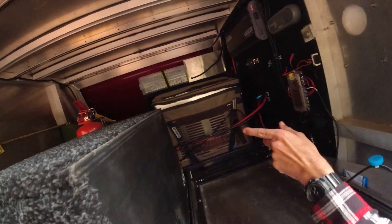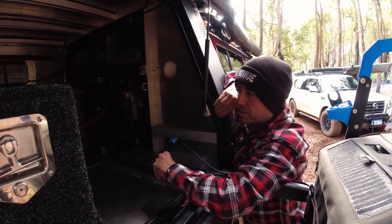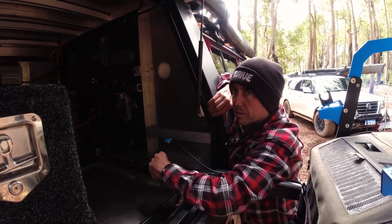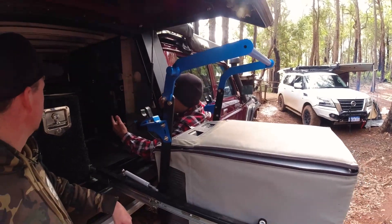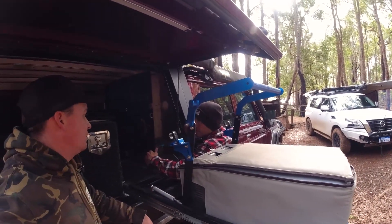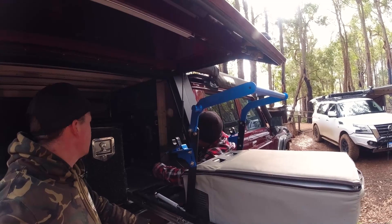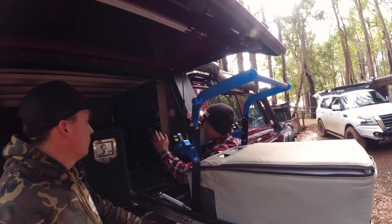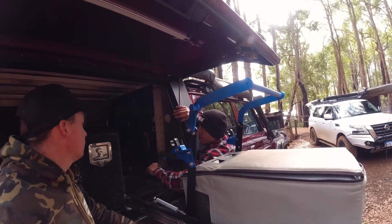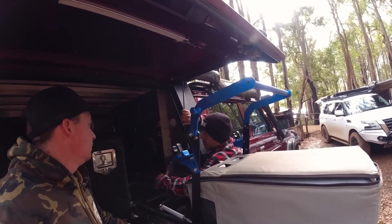The battery I got from Allspark Off-Road Living in Perth got destroyed in my rollover. But they've got another one — the 150 amp, which is just heaps. You have lithium in the old one, hey? Yeah, so I've got lithium again — another 150. So with two fridges and an oven, probably 15 amps easy — I can run those for like 10 hours if I wanted to. 150 amps is plenty. It actually stays pretty cool in this canopy. I don't know if it's because I've got more space now. My other one was pretty tight and packed in, so the fridges worked hard. Whereas now in this canopy, it's working well.